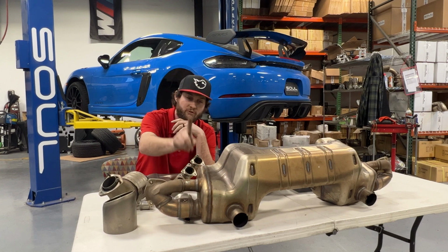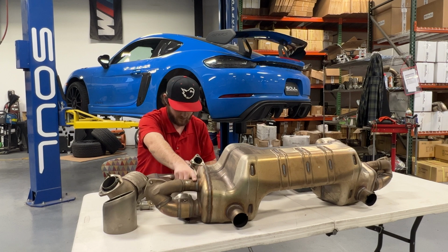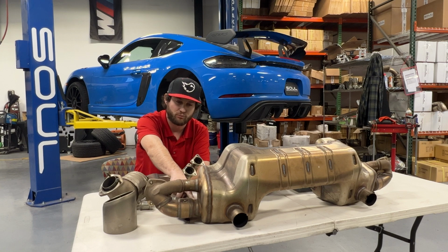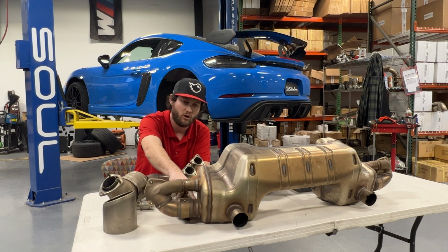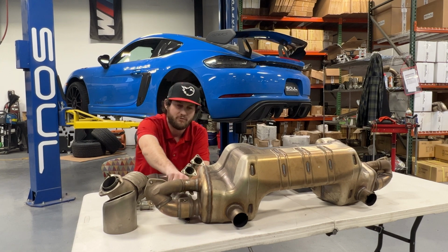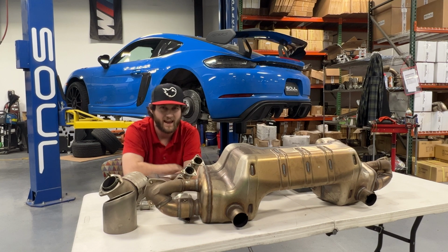You've got about 45 millimeters worth of valves-closed flow path on the top, which is, I would say, just about 1 3/4 inch, and you've got a primary flow path with valves open coming through the bottom of about 55 millimeters at this point, which is about 2 1/8-ish.